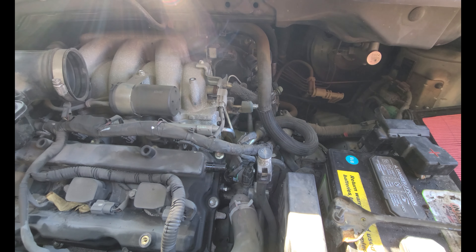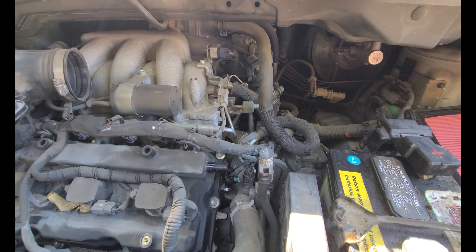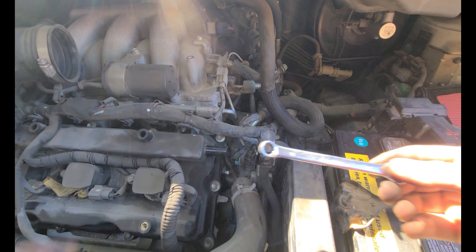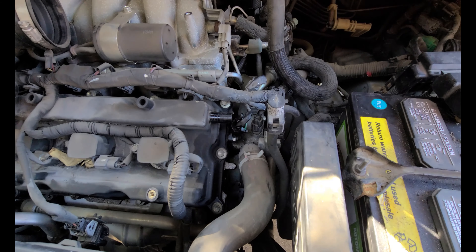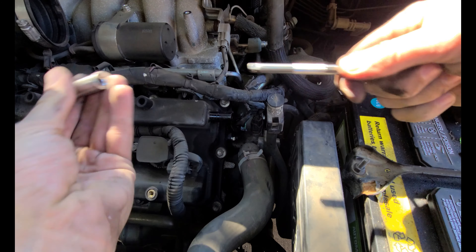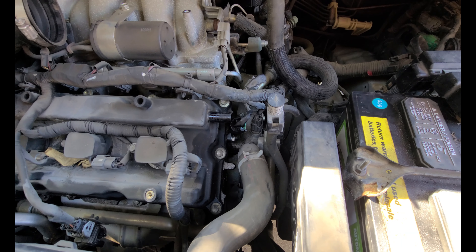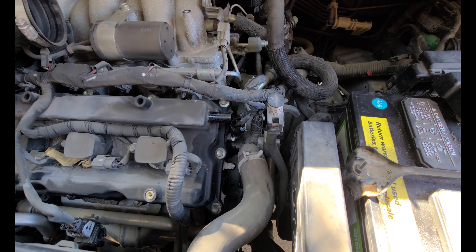I did this all in real time. You can see it only took a few minutes to get both of these sensors replaced — really not that big of a deal. All you've got to do now is put the intake tube back on and put your engine cover back on. The tools used were all pretty simple: a 10mm non-ratcheting wrench to break the front bolt loose, a 3-inch and 4-inch extension — a 7-inch total — with a quarter-inch drive and a deep 10mm socket, plus a U-joint or swivel for the front bolt. Using a swivel is just so much easier. If you have any questions, put them in the comments. Thanks for watching.